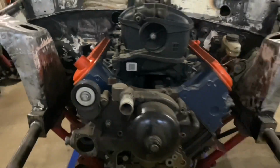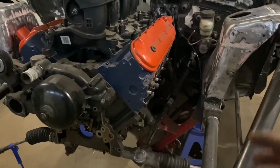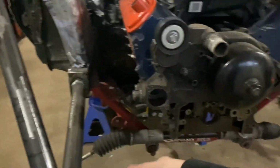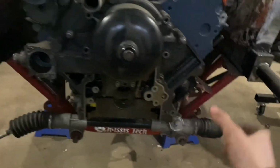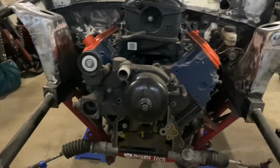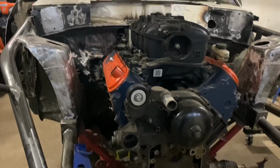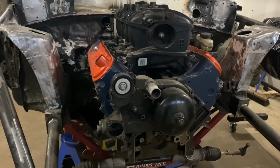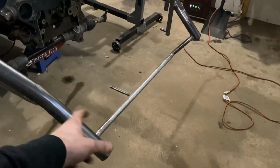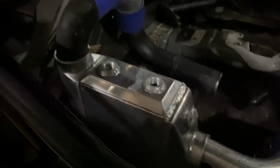And then I'm thinking about doing the eBay Flowtech headers, or PoTech, poor man's Flowtechs. Come out here, here and here. Basically just swoop up in the middle, almost like again 180 degrees, and just have a short turbo kit, right? So I like the idea of air to water, because it cools better and you can put the weight where you want it. Before I had like a 4-inch intercooler here off the nose, and that was probably 40 pounds off the front axle. So guys, this is basically my idea.